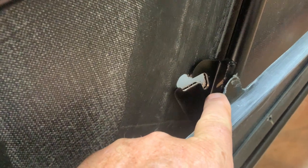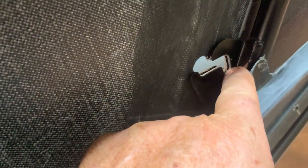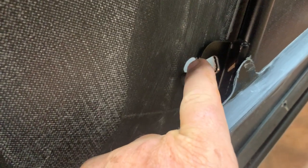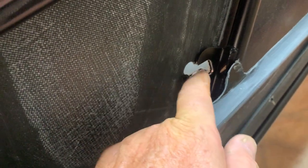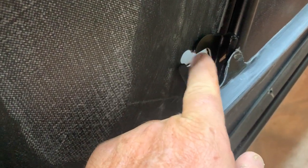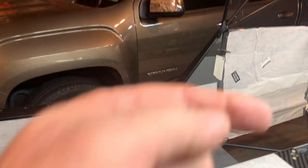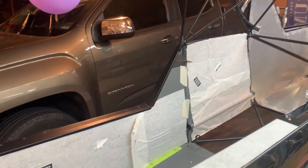Once you get these panels in place, I just take a big drill and drill a hole through there, and use the drill itself to round this out. Then you take a little rat tail file or a round file and open this out just enough where the end of that will come in here, then you can slide it in and pop it in, and then finish it off nicely. Same thing on the other side, just coming from the back side with it.